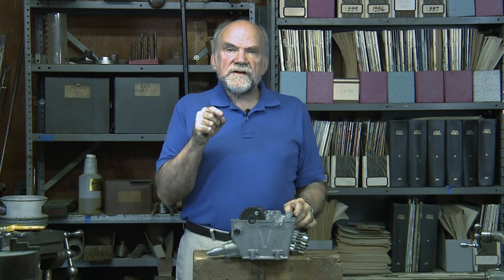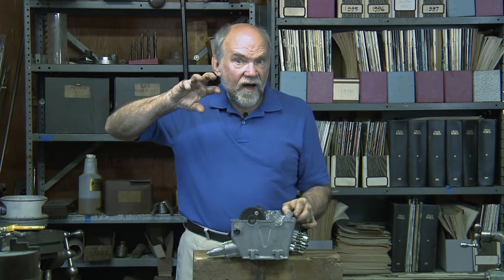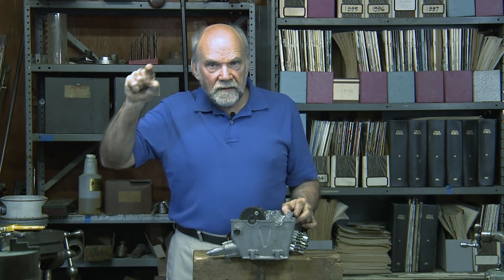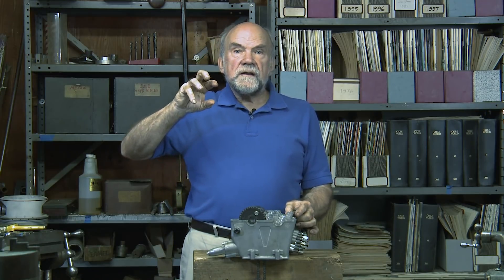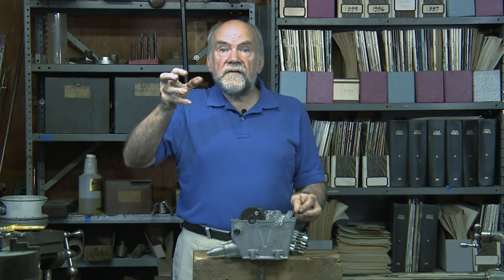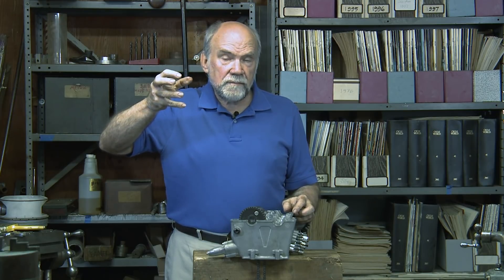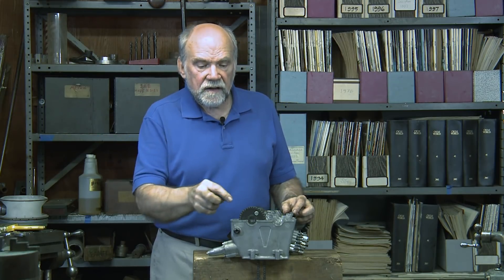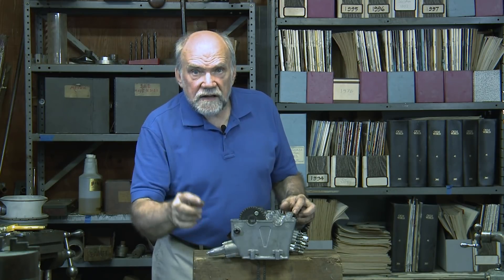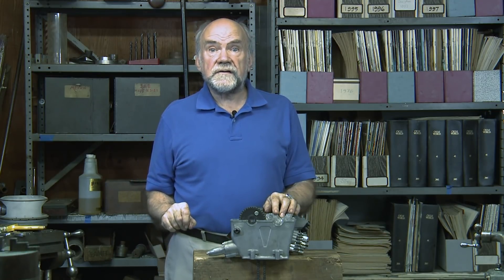This engine is powered by a series of combustion thumps, so the crankshaft does not rotate smoothly like a mill wheel in a beer commercial. Instead, it accelerates when the combustion in one cylinder begins, and then it slows as that combustion dies away. 180 degrees later, it feels another combustion event and accelerates again. So that yanking on the cam chain would set the chain to vibrating, and many stress cycles of such vibration would soon wreck the chain.